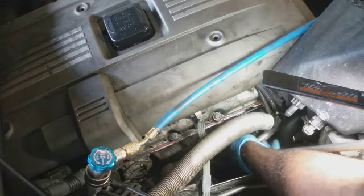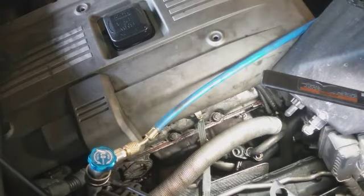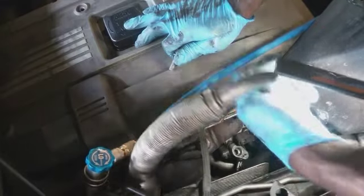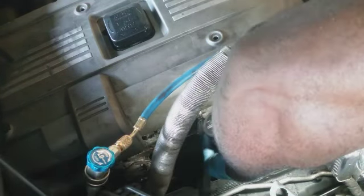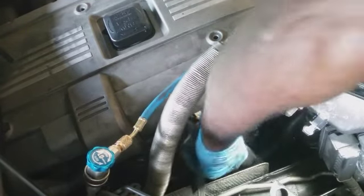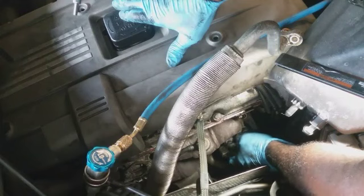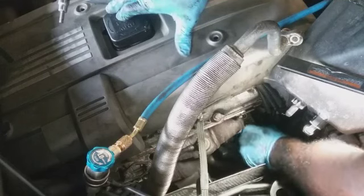Okay, I'm going to assume the compressor's leaking. You take that refrigerant line out, you break the line loose a little bit so you can lift up on the suction or either the high pressure side, so you can make sure all the pressure is relieved out of it. Put this in my little box. See where to line it. Alright.